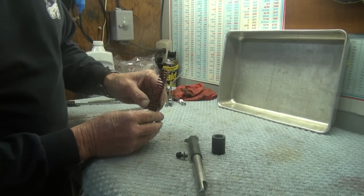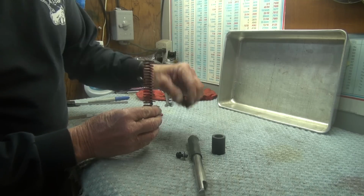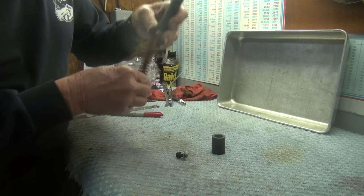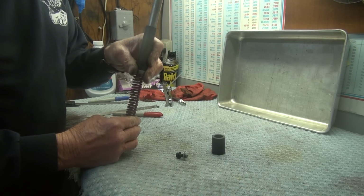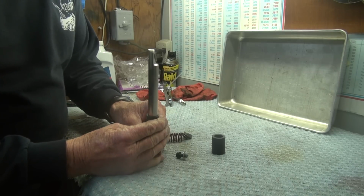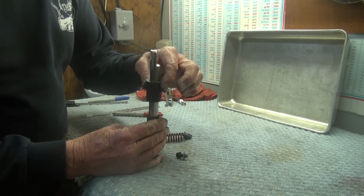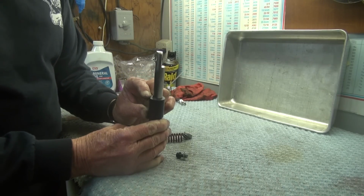And again, you put this guy together. There's my spring in one piece. And you put the rod on it. And you just drop this down into the frame. It drops right down to the bottom of the frame tubes. Then on top, you've got your rod sticking out of the frame. You take this Delrin bushing that I made, slip that on over, and that slips down into the top 1 inch section of the frame.